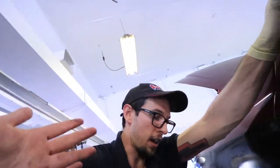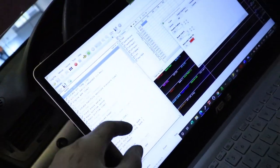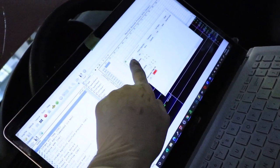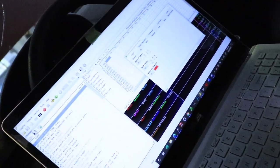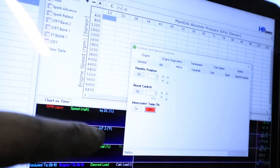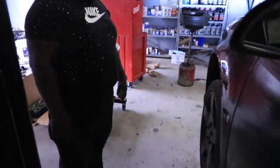We're testing the intercooler pump two ways: run the vehicle, or use HP Tuners. In the scanner portion of HP Tuners, once you connect to the car, hit the green button for functional tests, go to Engine Airflow, and there's an intercooler pump trigger. We already checked it — it's not functioning even when triggered. We have power, but we're not getting a ground.